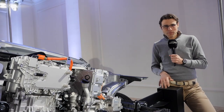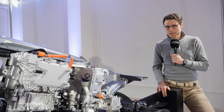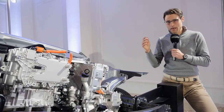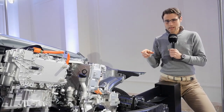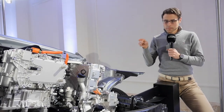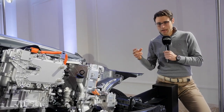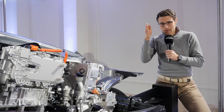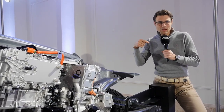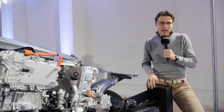Yeah, we know, for example, from past Mazda rotary engines that they're actually really high in the fuel consumption if you use all of the momentum and all different RPM areas. So why would they do that as a range extender then for the EV? First of all, the reasons I just mentioned. And the thing is, this one will not directly power the wheels. It will actually generate power. And in this case, it will run at a certain RPM level. And then you can actually let it run in a more efficient way, more efficient than it would vary in the RPM figures.